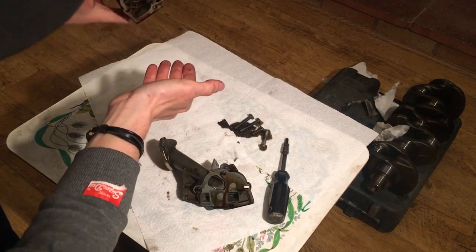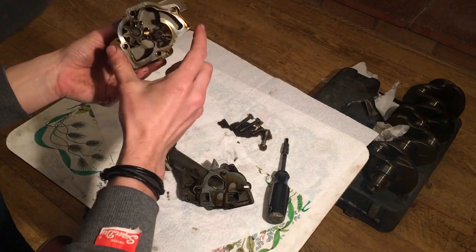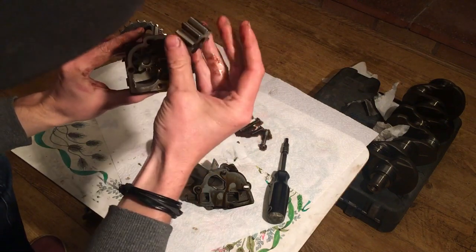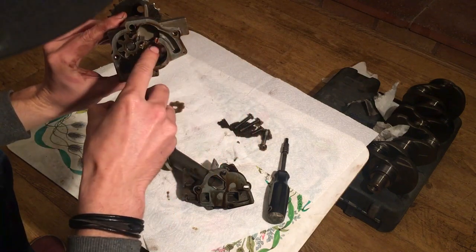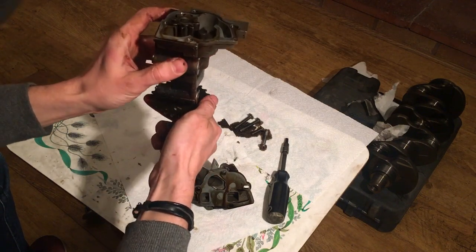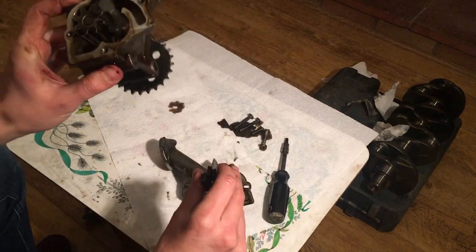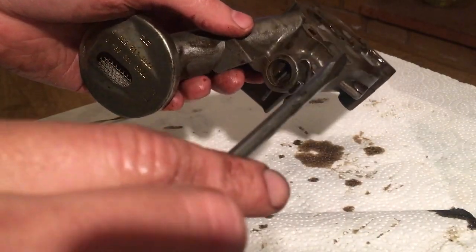You've got your slave gear and your driven gear off the sprocket. We're looking for signs of wear on the ends, signs of wear on the shafts, and any slack or play. There is a bit of up and down — don't worry about that, that's how it's meant to be. We're also looking for any damage at all. This one: nothing, spotless.